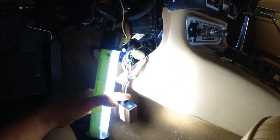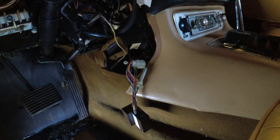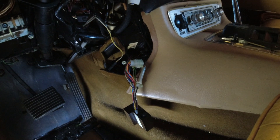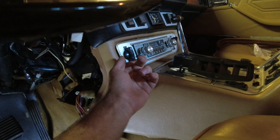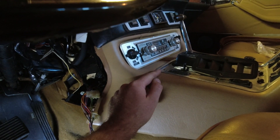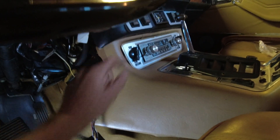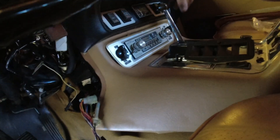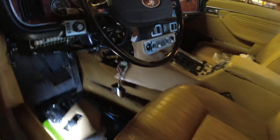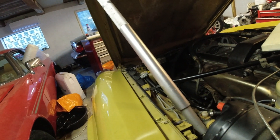You don't remove the old one - it's so difficult to get out, you really need to remove the heater box. So I'm just going to tuck this one up behind here. It's now on max cold and it's starting to move - it goes back, and it's a little noisy. I'm going to lubricate that on the other side. Very happy that it seems to be working. It will make the trip more enjoyable and I want to fix that for the owner.